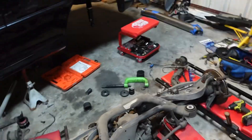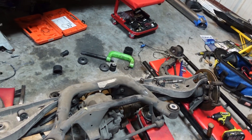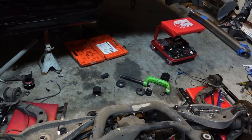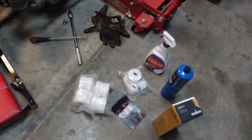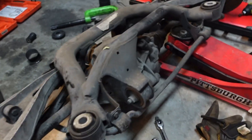Here's what we're working with today. I have the subframe — yes, I pulled the subframe — because we do have to weld the diff, and then I'm going to put these Condor bushings in the subframe and the diff.